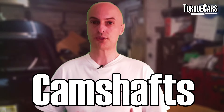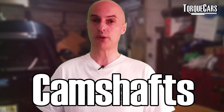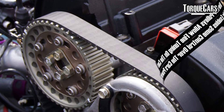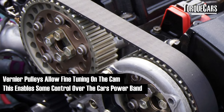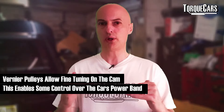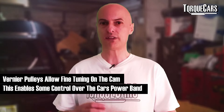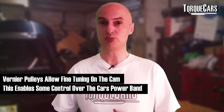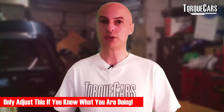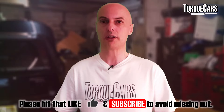There are a few camshaft adjustments that can be made on most 2 litre TDI engines, though you really need to know what you're doing. A few performance cams optimise the intake and exhaust valves and should be selected to match your map and turbo. Many TDI engines also have vernier pulleys, which allow you to slightly alter the cam orientation, effectively moving your power band up and down the RPM range. It's a fairly simple adjustment but if you get it wrong it really does disrupt the smooth running of the engine, so research thoroughly.